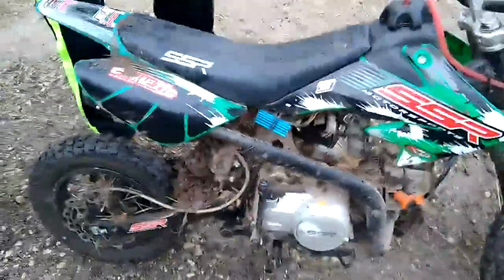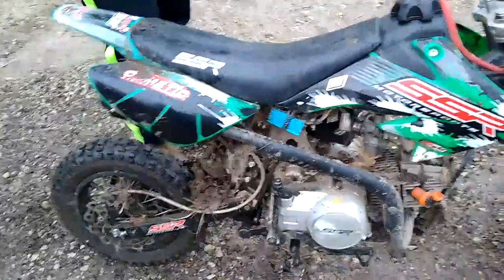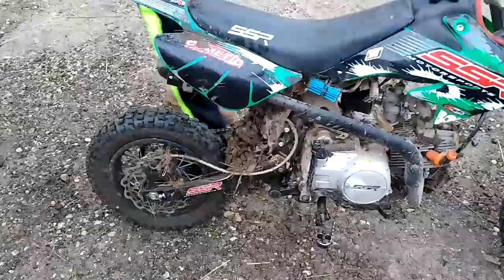It's completely covered in mud, but it's all red and orange. It's very stiff, very stiff. And you guys put it on the stiffest setting? Pretty much close to it. Now there's really no spring to it. Basically you want it to have no spring, so you can just pop it up. When it jumps or stuff, it's just going to bottom out. And for wheeling, it makes it pop up so much easier because it's a compress and release. I mean, Sparky can basically wheelie this thing, no problem.